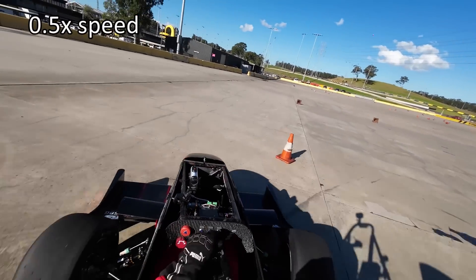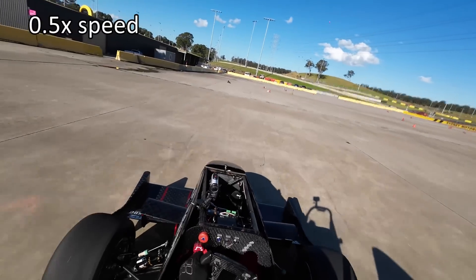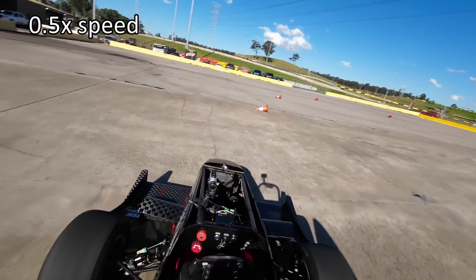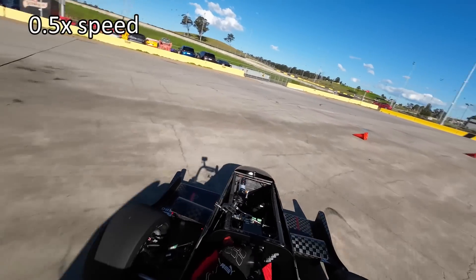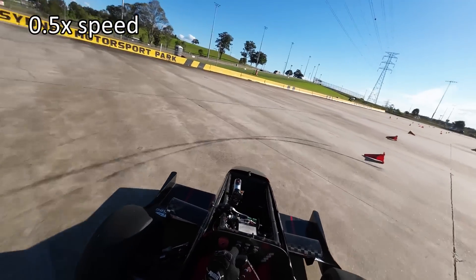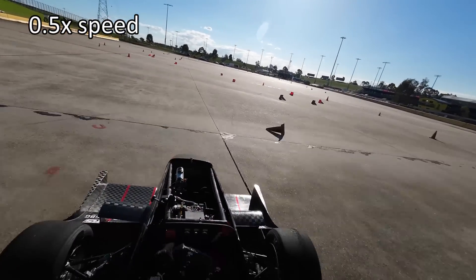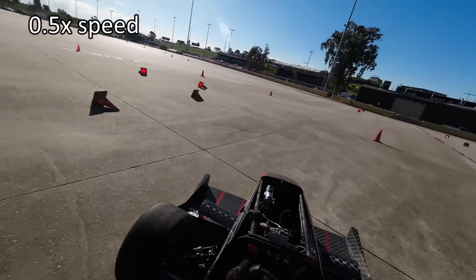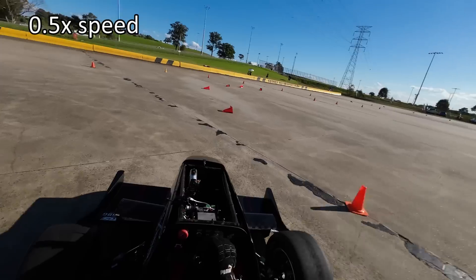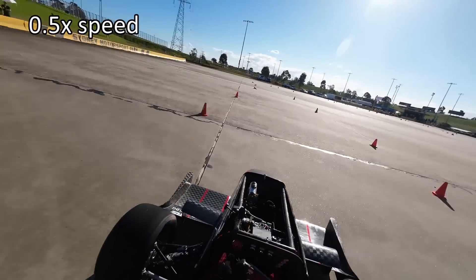In order to control the front aero, the front springs are quite stiff with respect to the rear springs. However, roll and heave aren't decoupled on this car, so they're trying to target quite a high front heave stiffness but they can't separate that from a high front roll stiffness. So the front roll stiffness is higher than they want it to be in order to ensure correct heave characteristics and correct ride characteristics around the front wing. This contributes to the understeer balance mid-corner, in addition to the excessive toe losing a little bit of ultimate front grip mid-turn.